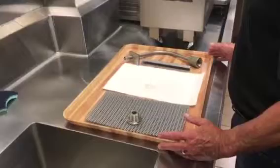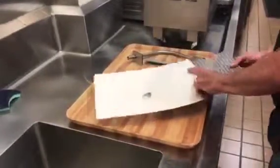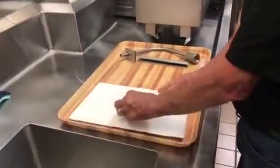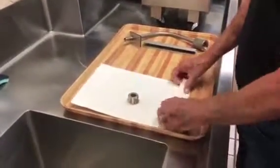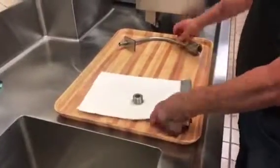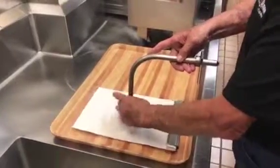These are the components of the filter tub. Insert the baffle into your paper, making sure you don't tear the paper as you put it in. Line up the hole, fold it over, take the clip, install the clip, take your standpipe, and securely screw in your standpipe.